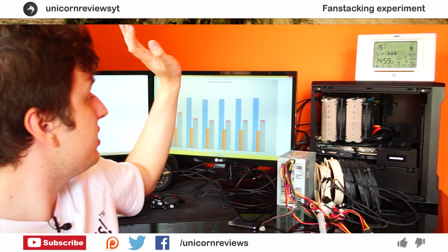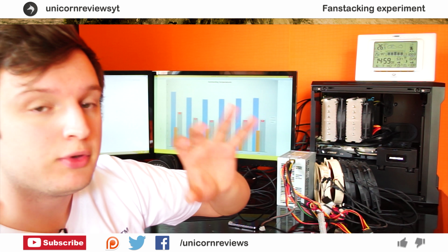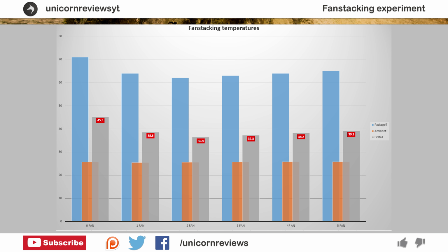But anyway, the interesting stuff, I'll put that one on your screen, full screen right now. But I think it's pretty interesting. So with no fans on there, we got a delta temperature, so the temperature difference between the package temp and the ambient temperature of 45.3 degrees Celsius, which is, I guess, okay. But then when we added a single Noctua fan, which is obviously a lot higher airflow than the Be Quiet fans, they're just made to be quiet, we got down to 38.6.